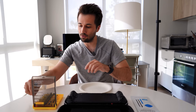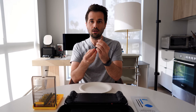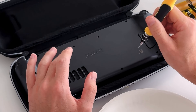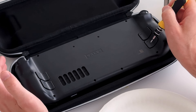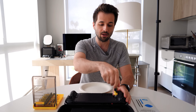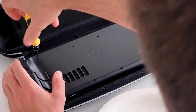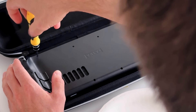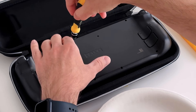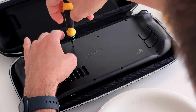The next thing we're going to do is use a Torx size 6 bit. If you're doing the Steam Deck LCD, you have to keep track of where each screw goes because the thread count is higher on some screws than others. Because these are all now Torx 6, I believe they're all the same length and thickness. When you're unscrewing this, you don't want to give it a lot of power, just enough to get it released. Use your paper plate if you don't have a magnetic pad to keep all of them in place.